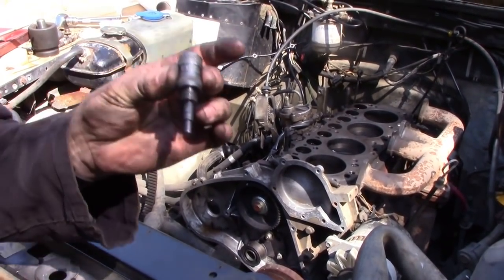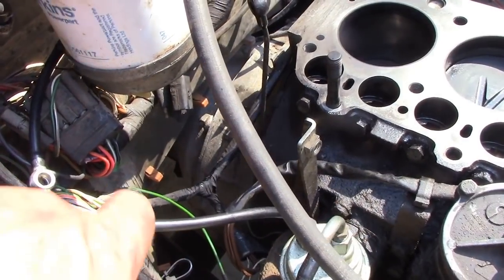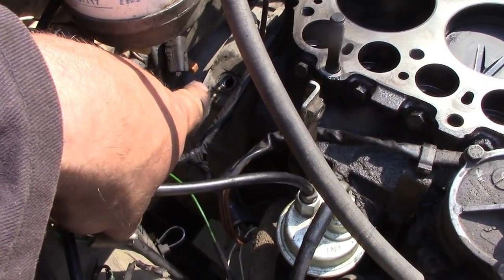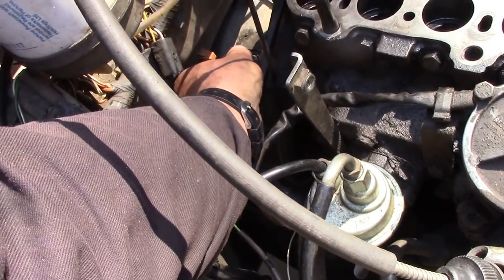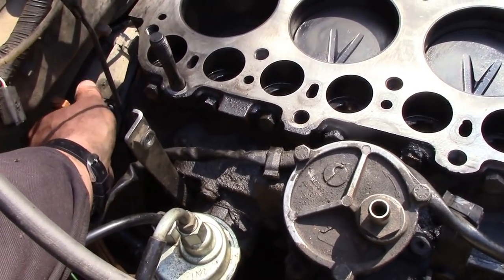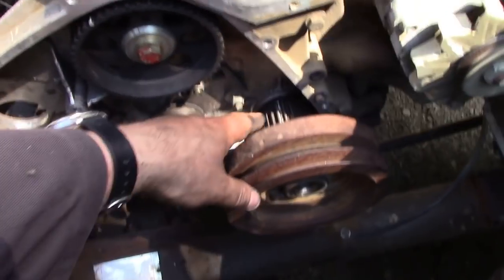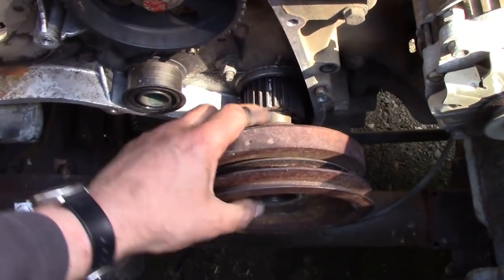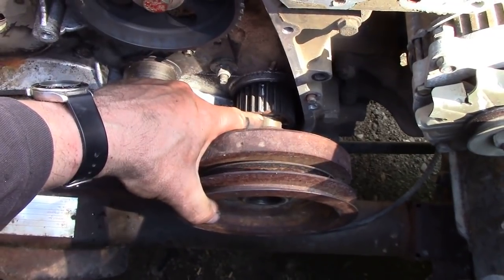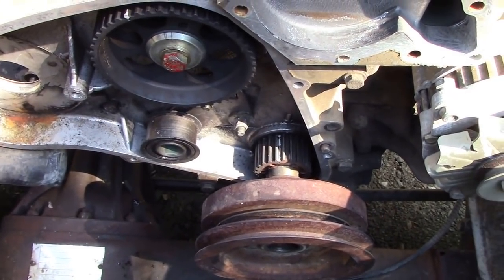These engines here, just to be Land Rover, they're a little bit different. What you need is a timing pin like this, and I'm going to show you where the pin goes. The pin goes in a little hole there — you can see it. It was a bugger to get out and it's a bugger to get in. Now fortunately on here, they've put a white mark here, and you may just be able to see down here — there is a dot for the alignment mark.